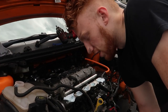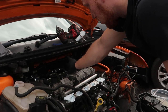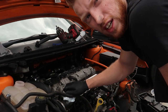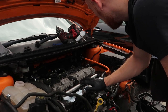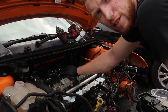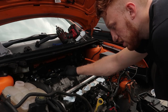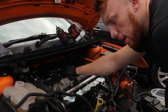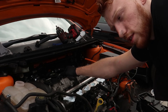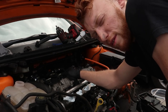This is where we're at so far: plenum's off, ECU holder's off, all the radiator and intercooler crossover, engine cover, plenum's out. Just swapped the injectors back to standard ST ones. Going to take off all the heater matrix hoses, get the rest of the coolant out, drain the oil, and then driveshafts. I'm taking the gearbox off because I'm keeping that. The RS clutch and flywheel are coming out and going up for sale. We'll resume once we're a little bit further ahead.